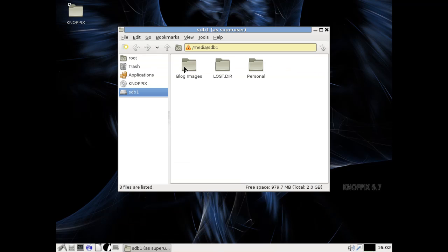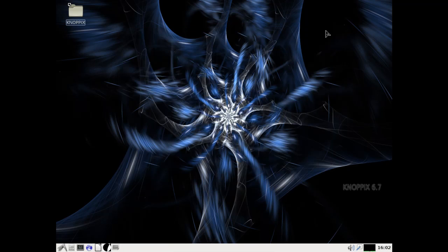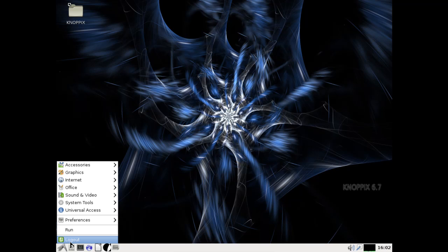At this point we've now rescued those files from that drive. If we go ahead and open them up on our external storage, we can see that they're actually there — we can see them, we can open them up, we can use them. If you wanted to manipulate those images through Knoppix, you could. Or you can simply reboot the machine. Once you get your version of Windows back up and running, plug that external storage back in, dump those pictures back onto the machine, and you're good to go.